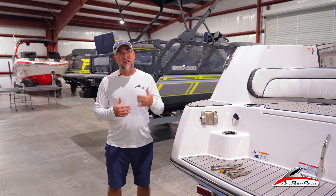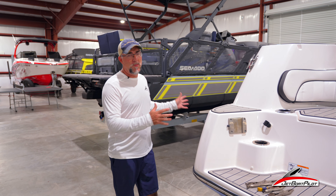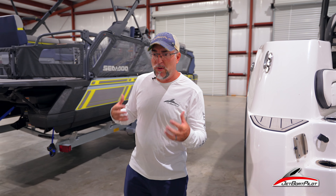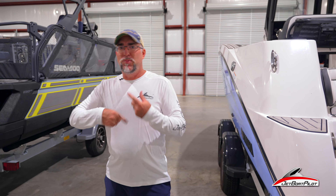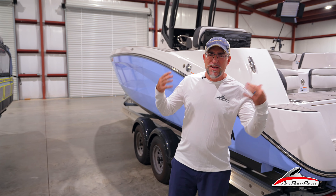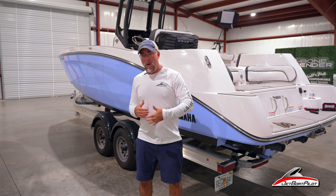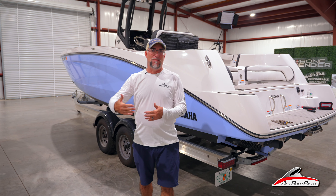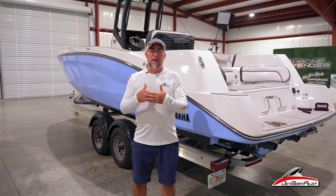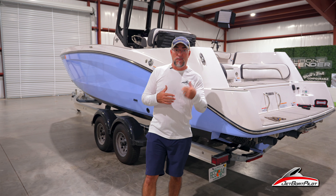Let's say you have an engine that's gone down, you'd have to call Sea Tow, or maybe somebody's towing you in. These engines require cooling water, and that water is picked up from the jet pump under normal operation. So if you can imagine, to get cooling water into your engine, the impeller is turning, it's pressurizing water in the pump, and that water is sent up through some ducting tubing into your engine and into your exhaust to give you cooling water. It's important to note that if your engine is down and you're being towed at speeds in excess of five miles an hour — like on the Sea-Doo — or ten miles an hour on the Yamaha, your engine is going to have issues if you have not blocked off the cooling water pickup from the jet pump.